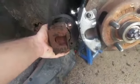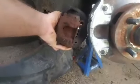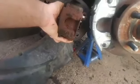We're going to do a little side-by-side comparison of the early one-bolt brakes to the later two-bolt brakes. This here is your one bolt in the center, two bolts on the caliper bracket. You see how much larger the pad surface is — the caliper surface is. The piston is also bigger. And you have the stability of two mount bolts rather than one in the center, where the caliper can walk back and forth. This is a much better brake system.